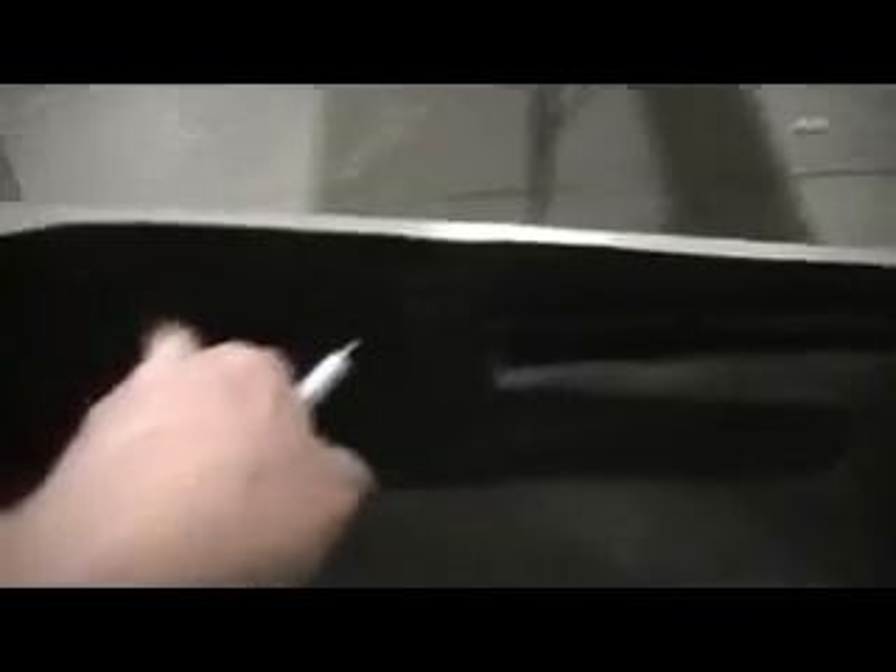Elevators, all good to go. I just got to get in there and mark them with the old Sharpie where to cut them, because they're too long — these shafts right here. I got to cut them off, so I got to mark them. Came in here with some more carbon. This is two layers — I put two layers up here and let it go down, then two layers down there and let it come up. So actually right along this seam it's four layers.